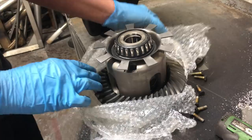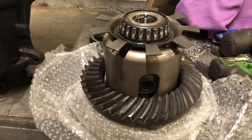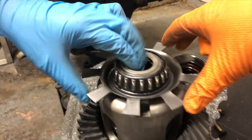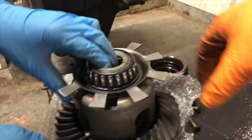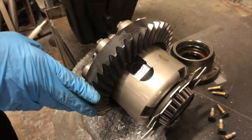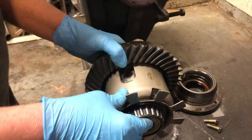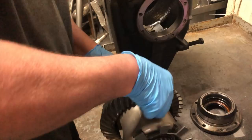New diff! It's a Drexler - but specifically one that's built and modified by Limited Slip Dot D. There it is - very fancy. He's built it with special ramp angles for us. It's a nice bit of kit - it probably should be for what it cost us. That is a ramp angle - not how the car sits on the ramp. Those there are ramp angles - you don't use a bubble level for checking your ramp angles.